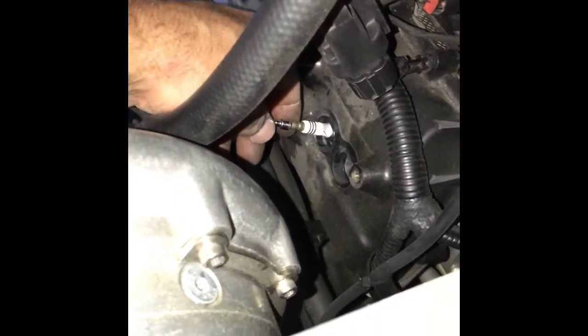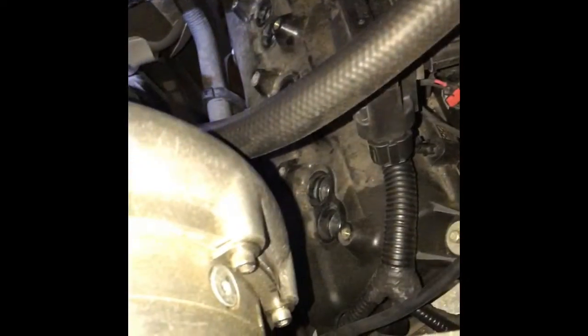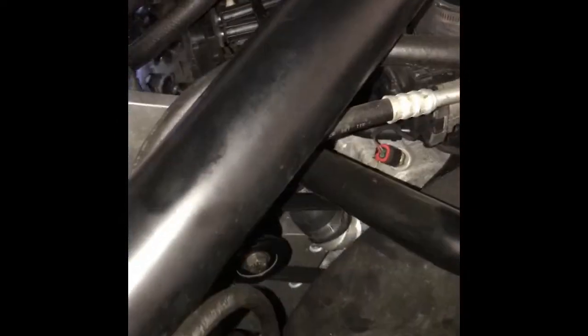Use the magnet, I put it in, grab the tip of my finger, let go of the magnet, drop it down, and boom, it's right there. You don't want it falling 6 inches, because if it hits the tab on the spark plug, it can change a gap. So you want to place it and not drop it in. And I grab my wonderful array of extensions and my 3/8 socket.